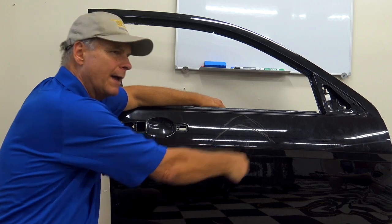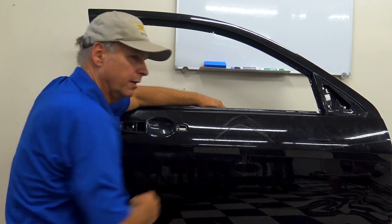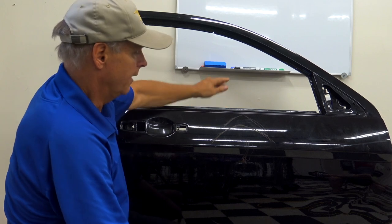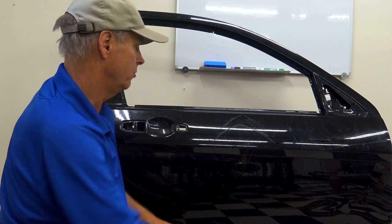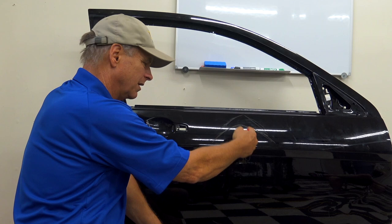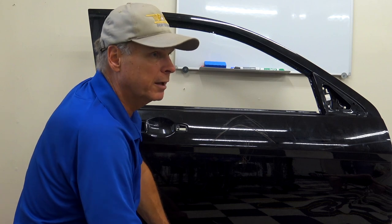You say, what about the impact point? We're not there yet. I want that body line hinge out of there. But I'm still looking for these pressure traps as I'm doing it. After that, I would probably look for any 45s. Don't see any? Good. How about any verticals? Usually on a body line, you don't see a lot of energy went right into that body line. I'm gonna check anyway though. Okay, everything's cool. Now I'm gonna go for my impact point.